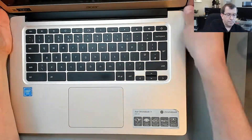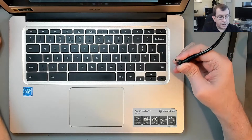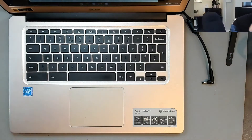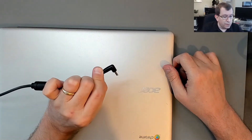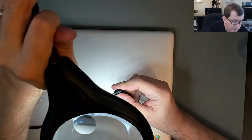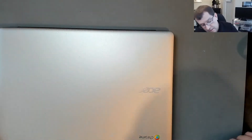No charge light. This feels quite loose, so I suspect the connector inside the laptop is broken. Plugging the charger into this port — this port looks okay — but there's obviously a problem, because plugging this connector into that charge port caused it to melt. The plastic got very hot and began to melt. You can see some of it sticking out here — it's just black plastic that's melted. So something is shorting inside the laptop. Whether that's the power connector or something else, I don't know, and I'm not exactly sure how I'll find out.